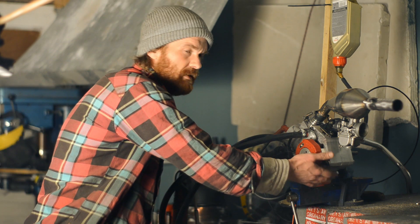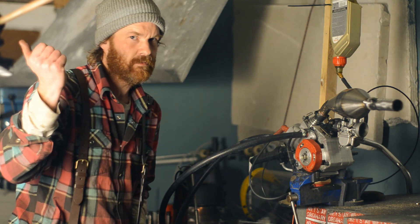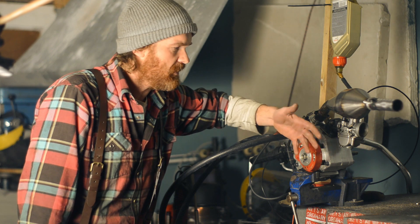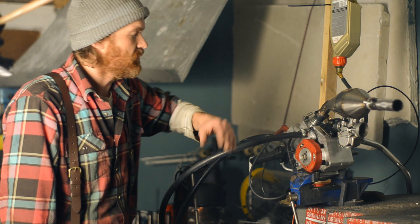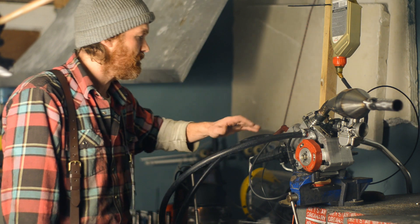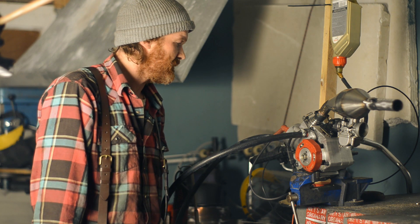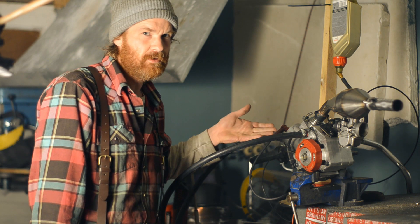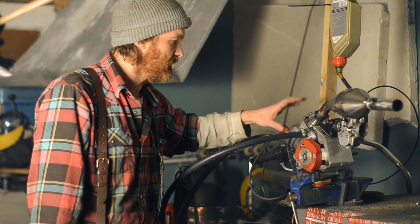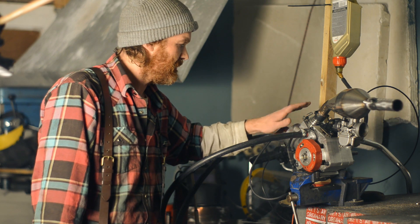There's no point in hooking up the secondary intake — that always-open intake — and testing it here because there's no load. It's meant to be run under constant load, constant high RPM. Works better than the previous design. Works like a normal piston ring, because it is a normal piston ring with a hole in it and a pin to retain it. Didn't snag either. See you next time!